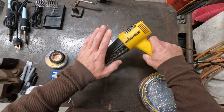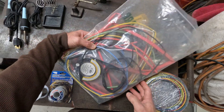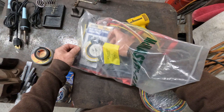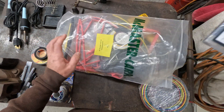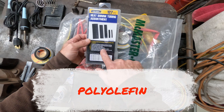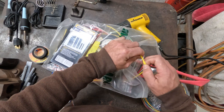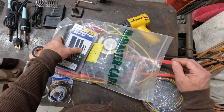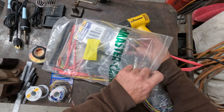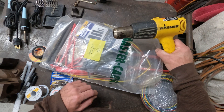You'll also need a heat gun. I have tons of heat shrink in different colors and sizes — this is polyolefin heat shrink, a satin color with a good shrink ratio, most commonly used in automotive applications. You'll want an assortment of sizes depending on what you're doing. Use a heat gun to shrink it — not a lighter — you'll get a much more professional quality look using the appropriate tool.